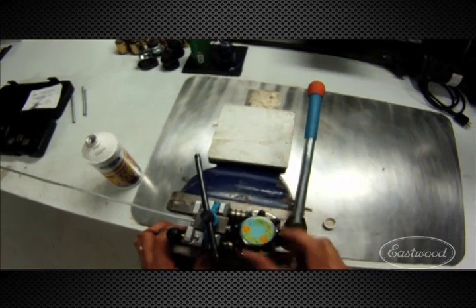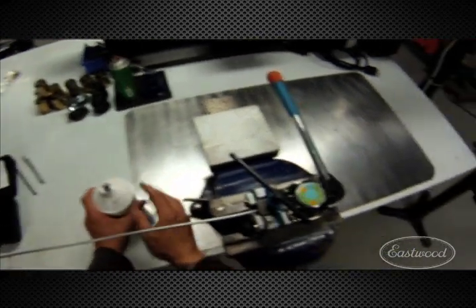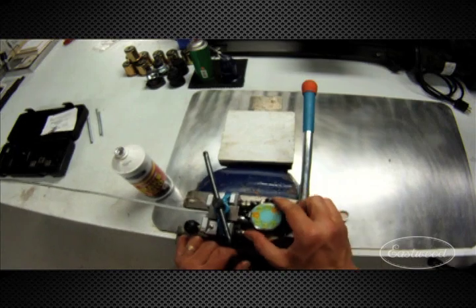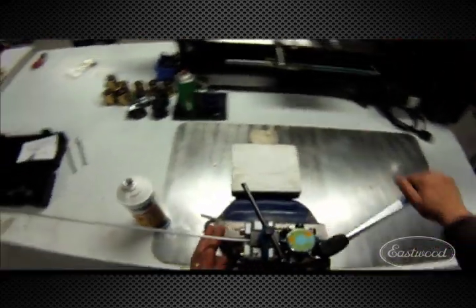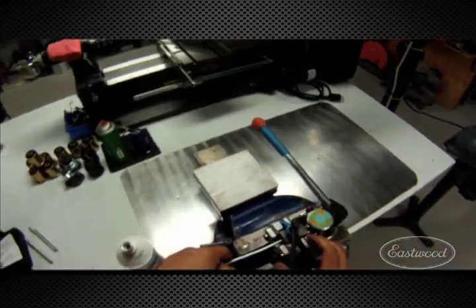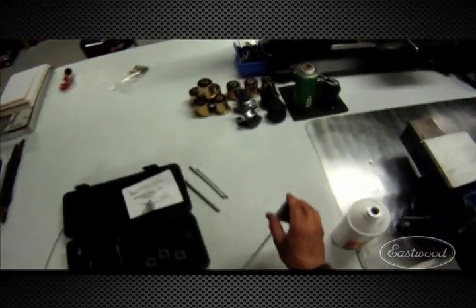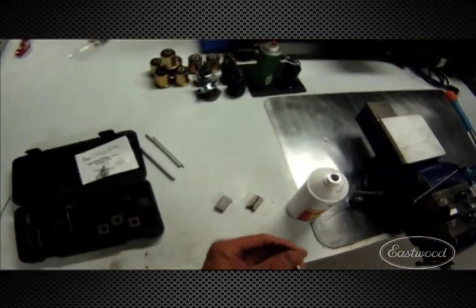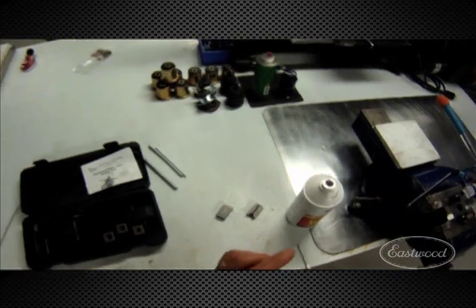Once you've pulled to the stop, go to operation 2 — op2 for 3/16, right here. Again, give it a little splash of lubricant, spin it around. Now let's check that out — that's the flare you're looking for. That's exactly what you want.